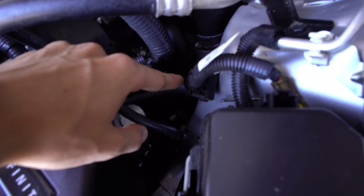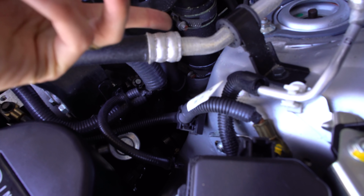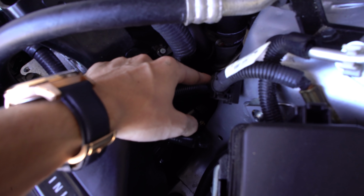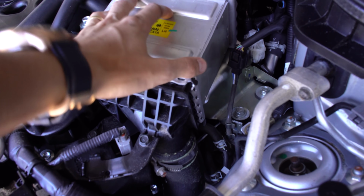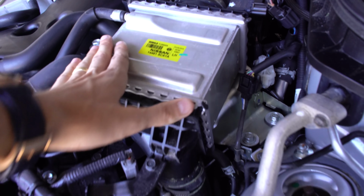Now, that charged air, right, heats up. We're using exhaust gases, exhaust output from the engine to turn the turbo. But the air that comes in from the front that's pulled in gets forced through the turbo, spins really fast, heats up, that's boost pressure building, then it gets thrown into the intercooler. The intercooler is an air-to-water setup, which means that normally, like if you look at some older school Japanese cars, they're gonna have air-to-air intake setups, and you'll see an intercooler down here, and that's just an air-to-air intercooler setup.